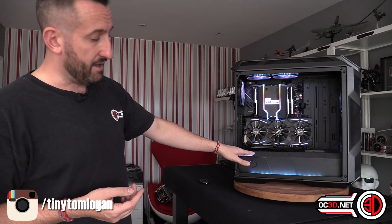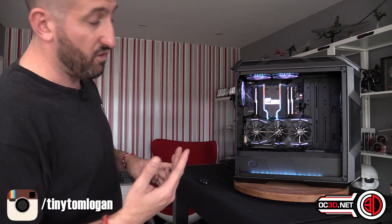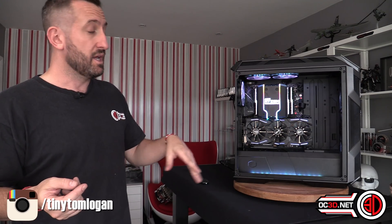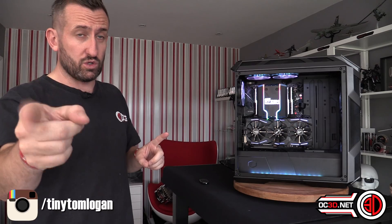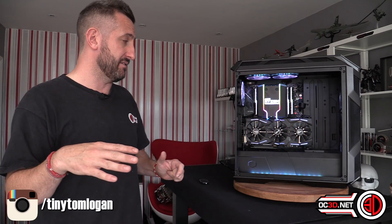The difference between the top of the power supply cover and the actual cooler itself might be different on your case. If you run into issues like that, you may need to trim the tabs on the bottom of your GPU. If you do that, don't forget about warranty — what I would then do is go on eBay and look for a spare PCI bracket in case you get issues. Also, on your riser cable, if you've got the PCB on the bottom with the pins on the back, make sure you get some foam, electrical tape, or liquid electrical tape to cover up those contacts on the back so they don't short on your case.